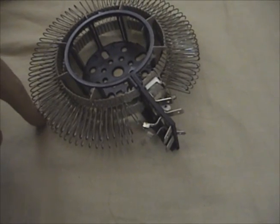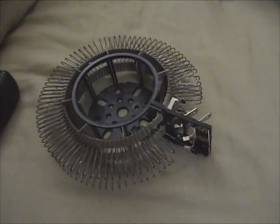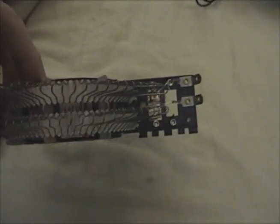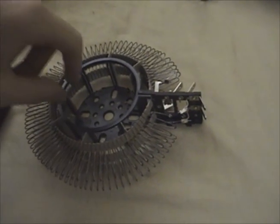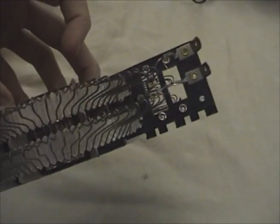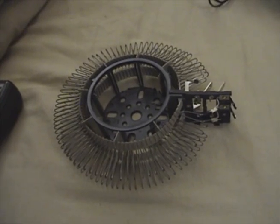Here's the heating coil. After figuring out how the two coils are wired, I measured the resistance - came out to 14 ohms, which works out to 900 watts. The two coils are actually connected in series. On the 900-watt mode, both coils are in series. When you switch to the 1500-watt mode, it shorts out one of the coils so just one sole coil is connected to power. It might seem unintuitive that one coil running creates more heat than both coils, but it's because they're in series - the resistance is more, and power is voltage squared divided by the resistance. So by shorting out one coil, you get less resistance, that one coil glows hotter, and you get more power and thus more heat.